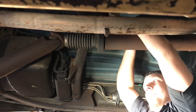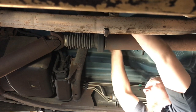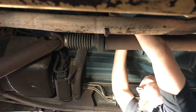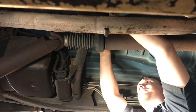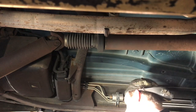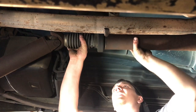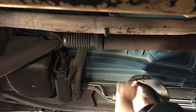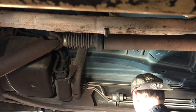So this rear drive shaft is a two-piece, and it's got a hub, or a, what do you call that, a carrier bearing in the middle? Yeah, whenever the whole thing comes down, we'll check the U-joints. Okay. We'll check the carrier, the front and rear U-joints we'll check. There's a little bit of slack sometimes when you take off. I could feel it. But it's not there. Okay. This is good. Good, carrier bearing's good.